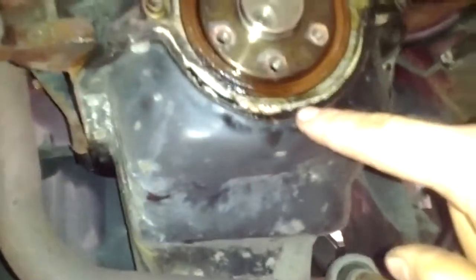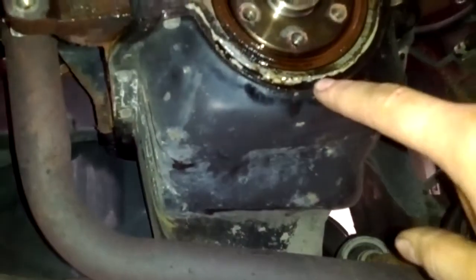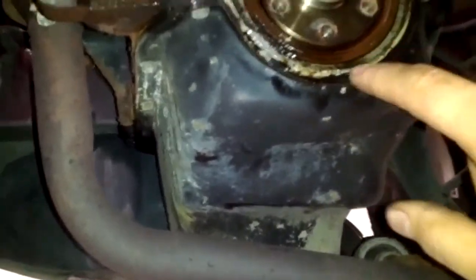We're under the Tercel here now. Got the transmission out — it's 5:39. I also took the back plate and took the flywheel off. You can see it's oily city here, most of it from the crank seal, possibly some seeping out of the pan as well. But we won't worry about that today — we can do that another day.